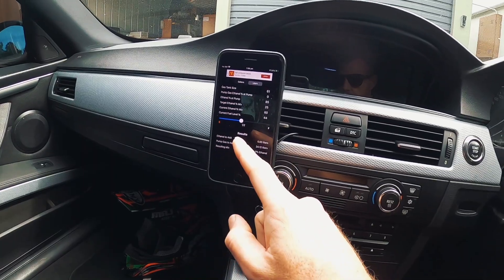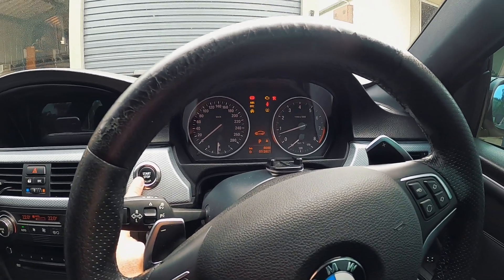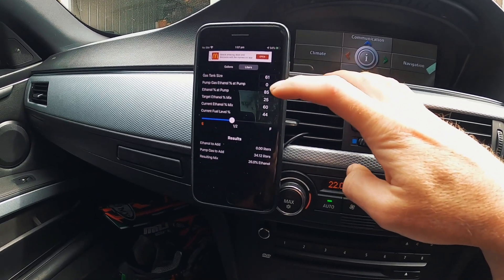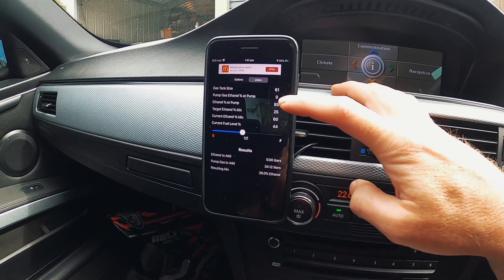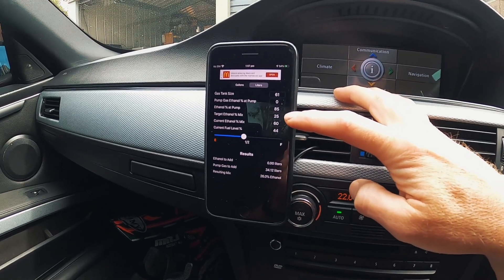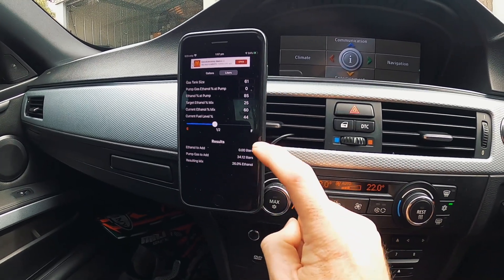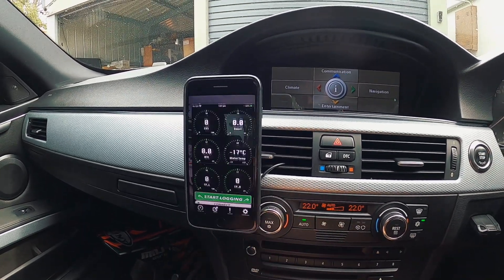So the app — basically what we've got here. The car is sitting just under half a tank of fuel, which is what we've got set here. I've set it around a 61-litre fuel tank — I think it's 60 or 62. The pump fuel in Australia, where I'm going to get fuel from, doesn't have any ethanol in it, so we've got zero ethanol content in the pump fuel. When I run E85, it is E85 fully. I'm going to target a 25% ethanol mix — so that's an E25. The car's currently got about E60 in it. If I don't add any ethanol, I'll end up at around an E26 mix, so that'll be perfect to test that the flex fuel tune is doing what it's doing.